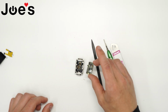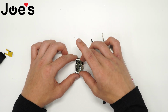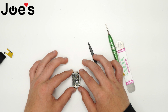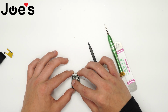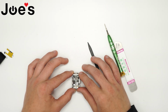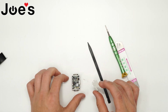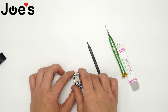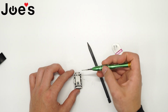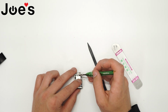When you go to replace it, you want to put it in to where the ribbon would connect to the connector. It slides in real easy. So when you put the board back in the housing, you want to connect your back housing ribbon to the board. It should connect really easy. You'll feel it clip in. When you have that squared away, go ahead and put your metal shield over your board. Put the screws back in.